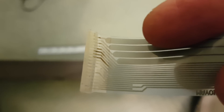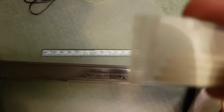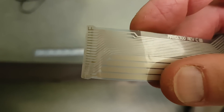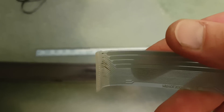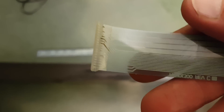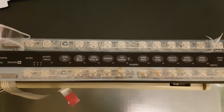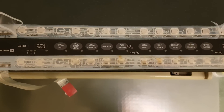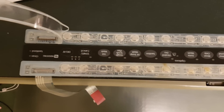Particularly when you discover that the problem isn't in the membrane touch panel but in this little flat plastic cable that connects it together. For the lack of about 25 cents of water sealing, Maytag/Whirlpool/Amana/Kenmore — they make all those brands — have built into them a flaw where the control panels fail. It's not the control board, it's this little piece of wire, and it's a type that's almost impossible to solder to. By holding onto the old control panels, I was able to do some reverse engineering.